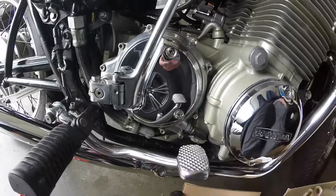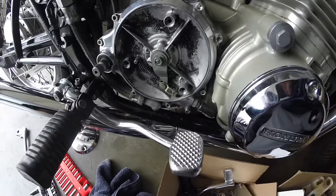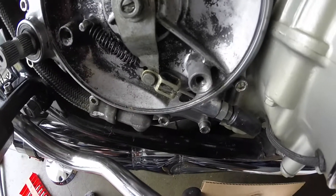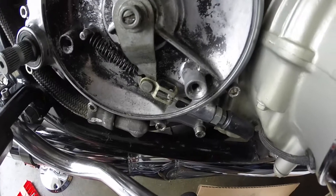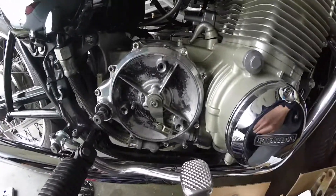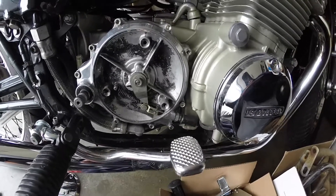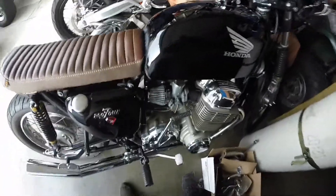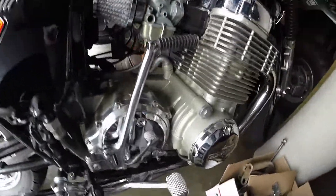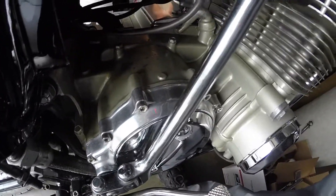So we got in there. It looks like the cable is moving in there — the clutch cable — but it's broken somewhere along the line because there's no tension obviously. Take out these screws a couple threads and we'll see if we can determine where the break is. Okay, so it wasn't the cable — the bolt in there just kind of came off, but it seems to be working now.